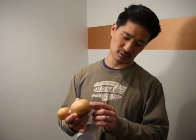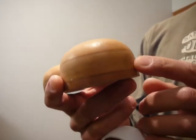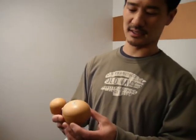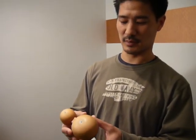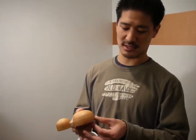If you look closely, these pucks were resined. It's actually 2 pucks of 3/4 inch MDF glued together. This additional puck was glued on later just to give it additional clearance for the mid-range speaker. And if you can see, they're not the same height. This one's actually 1/4 inch taller, just to give it a little bit different look in space.